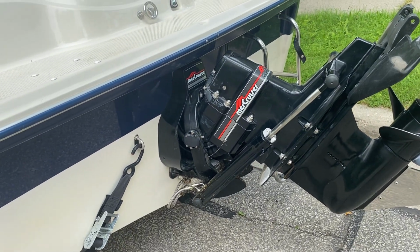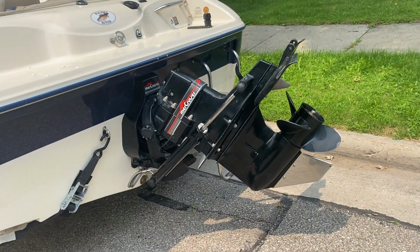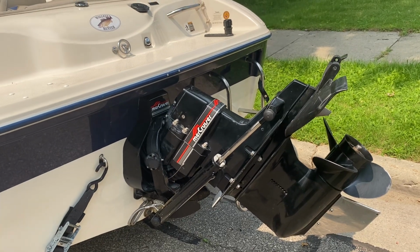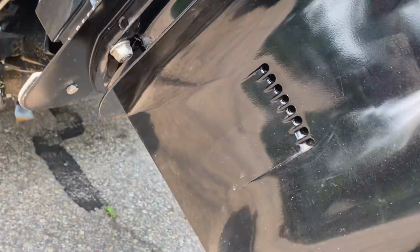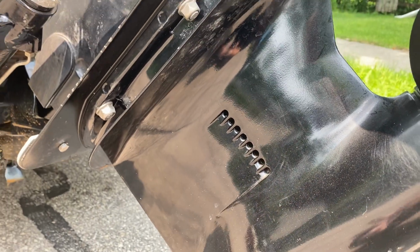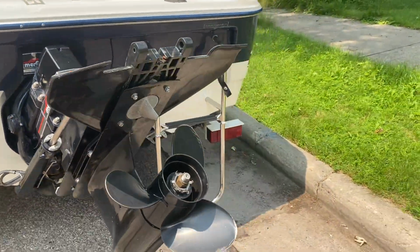A boat like this, I can't really start in a place like this. It has to be in the water because we don't have antifreeze like cars. So it's bad for your motor if you start it up like this. What happens is, when you start your boat, this thing right here, and it's on the other side too, sucks up the water into the tubes and then cools down the engines. That's how it works.